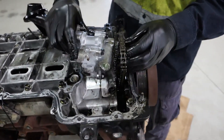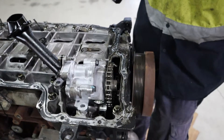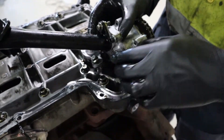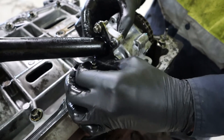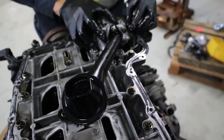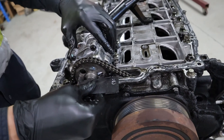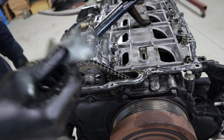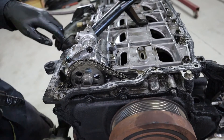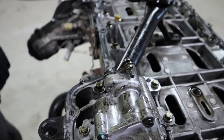Fit the oil pump. Since you've already tested the O-ring and know it's working, just leave it on. You'll have to put the pickup screw in first — if you screw all the other bolts down first you won't be able to get it in. If your oil pump wasn't broken, you'd normally push the pump up to the tool and tighten the four bolts. Because this one is broken, we're just going to line it up by eye and tighten the four bolts. Note: the pickup bolt in the corner can't be reached with a ratchet, so you'll have to use a spanner.